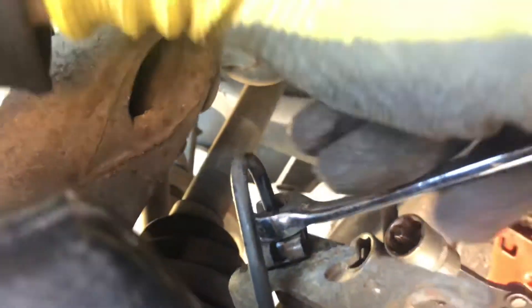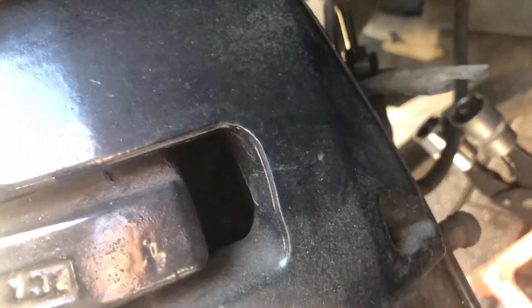But this one obviously is exactly the same as the other side — it's moving that steel pipe. What we're gonna do, I'm just gonna cut this one off, remove the steel pipe from here, from there, from the caliper, and also remove the holder. We're gonna go to the bench and change that. I also have to check if this one's gonna go nice and easy. Yeah, twisting nicely — let me take that holder off first, cut the flex pipe here and let's take that to the bench.